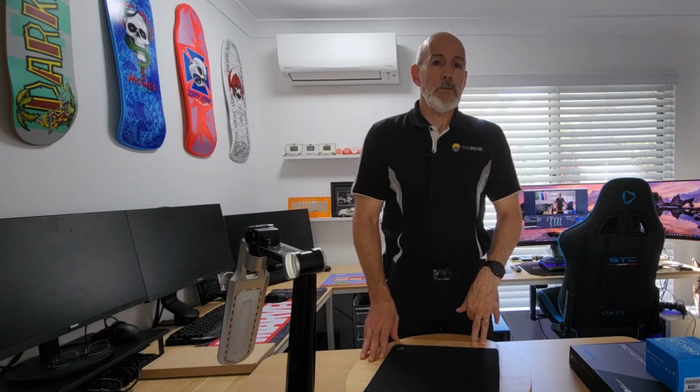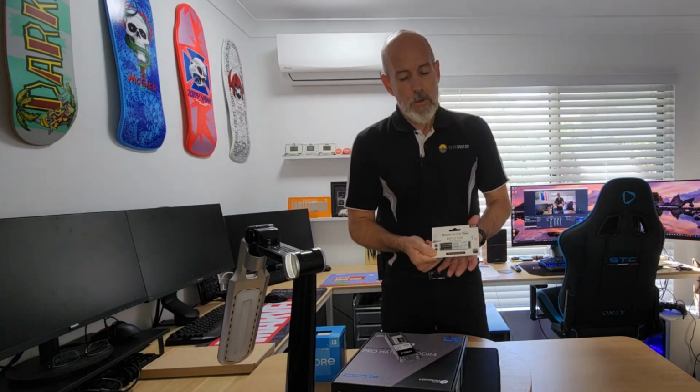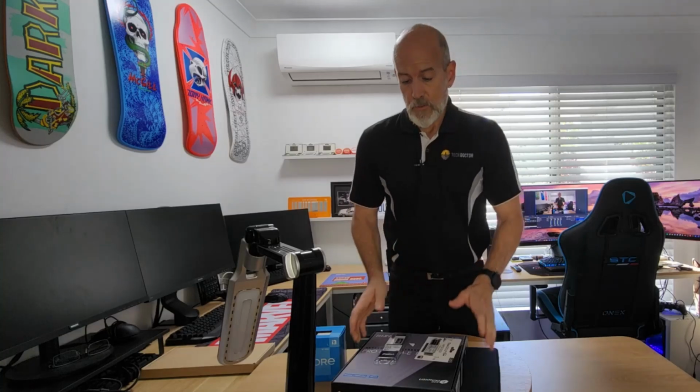So what we're going to do is a build of a basic one. We've basically got a 12th gen i3 with an MSI motherboard, 8 gig Crucial DDR4, and a Team NVMe 1 terabyte drive. So we're going to build it up, install Windows 11, get that all sorted, and then it's off camera. I'm going to do a clone of the existing drive, because he's got a few things on there which are a little bit difficult to come by. So that's what we'll be doing.